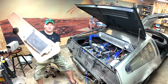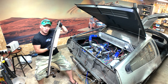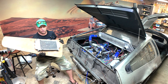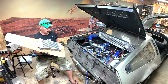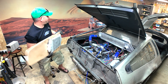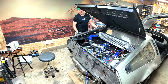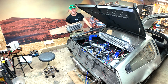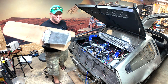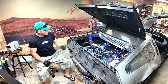I did some research and found that one of the smallest intercoolers on the market is from an R52 Mini Cooper S. It's about two inches thick, yes it has some weird oval shapes on either end that would need welding, but it's really slimline and we could probably fit it in. The problem was once I did fit it in, it still interfered with the bodywork, so that idea was written off as well. Knowing that's one of the smallest ones available without going heavily custom, we basically had to abandon that and go back to the original.